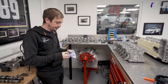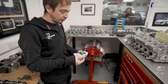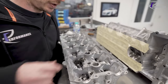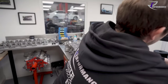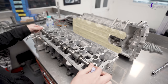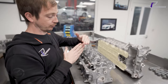The tappet is fed oil pressure - it's basically an adjustable tappet with a one-way valve in it. Oil pressure will expand it and because it's a one-way valve it can't decompress. It's got a bearing roller on the top that drives on the cam, and then it's got the foot to sit on the valve. The roller rocker will then push against the tappet which doesn't move, and that keeps your valve lash adjusted. It will just roll down on the valve.